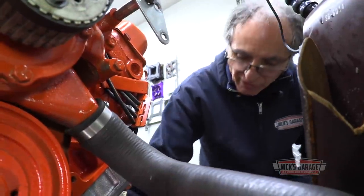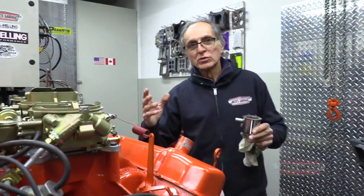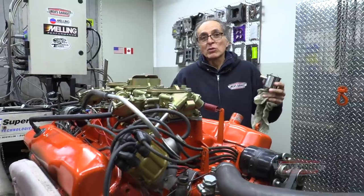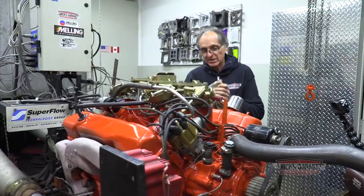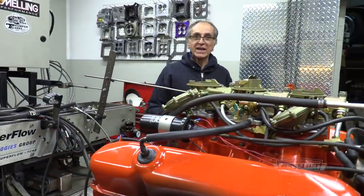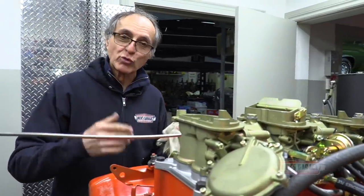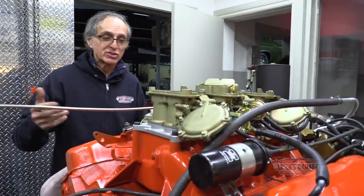You know, there's another good thing about a dynamometer. You've got a dynamometer here. It's a tool that's used to measure horsepower and torque at a certain RPM. Where is your torque at? What RPM? And what's your horsepower at what RPM also? It is a measuring tool, and that's what it's used for. But of course, you can also use it for running the engine, breaking in the cam, tuning it, playing with air-fuel ratios, playing with different carburetors, looking at valve lash, oil pressures like we're doing right now, listening to noises, looking for exhaust leaks, water leaks, vibrations, you name it.